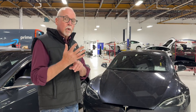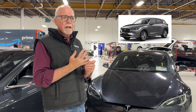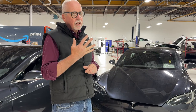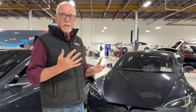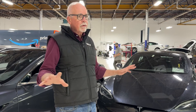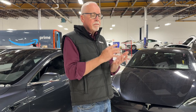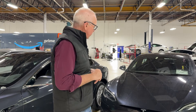Let's talk about a four or five-stage color. On the Mazda, for example, there's a machine gray and a candy apple red — that's a five-stage color. The first stage is the undercoat or sealer itself. They use what's called a G-shade: the sealer applied before any color goes on the car can range from white to black, with seven different gradations. Today, that sealer is actually used as part of the color — it makes the basis for the other layers, and you can see it through them. In the past, you'd get 100% coverage, but that's no longer the case.